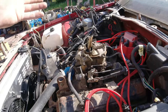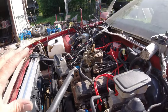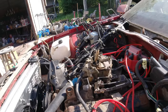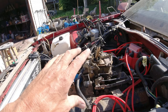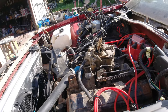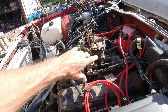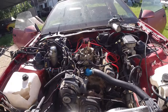Just an electronic carburetor — I'm not sure what all this metering thing is. The thing has had lots of bad gas in it. I drained it all out except about one gallon I couldn't get at, put in four gallons of good gas mixed with it, and added three different kinds of additives — STP and Barzol or something. It runs good but the idle will die and then it'll run on. After it runs for a while and you turn it off, it'll pop, pop, pop. People were saying if you don't have the electrics hooked up to it, it'll run bad and stall and leave you stranded. So I ordered another Chinese carburetor.